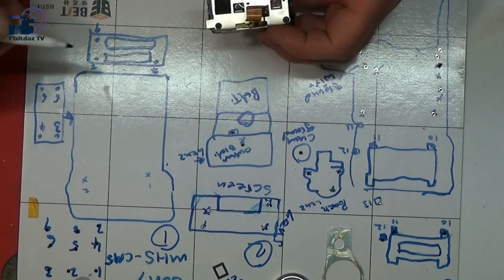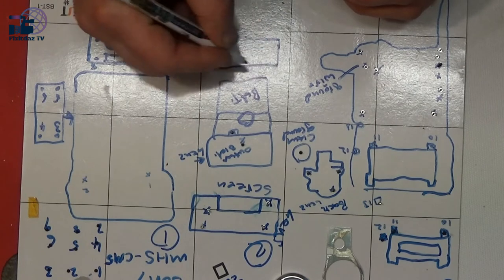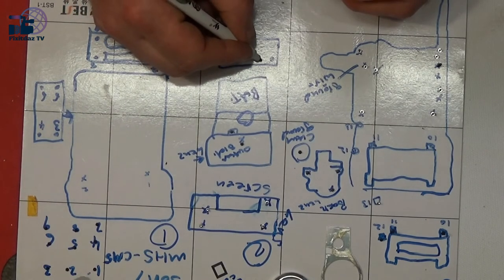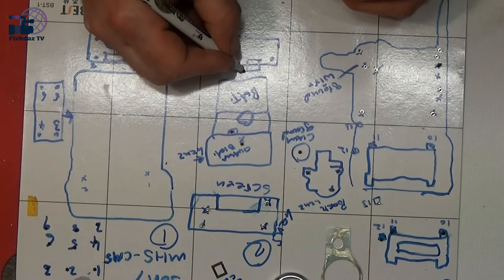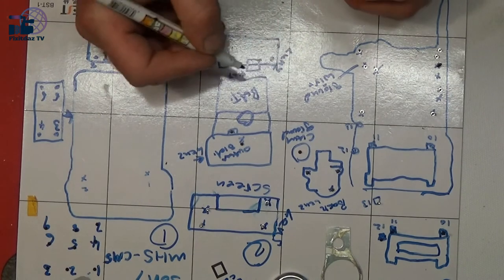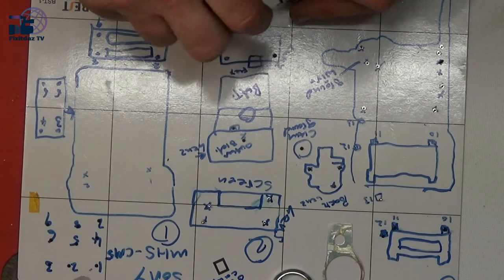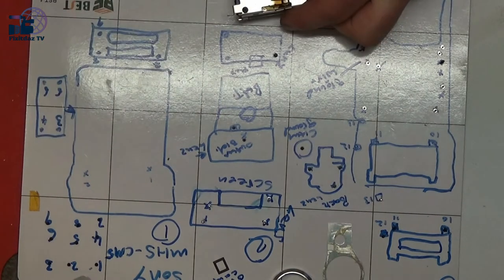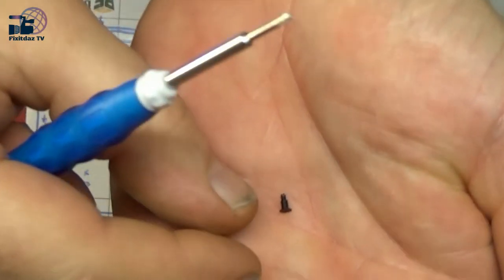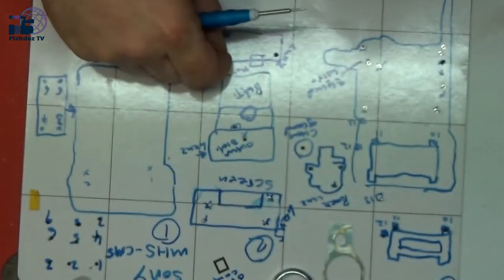We've drawn that up. Let me just draw this up so we've got the base of it. Running out of space here, so I'll just draw that. We've got 1, 2, and 3 screws, and flex cable, and the lens is here. Lens. So these, yeah, these are special screws. You've got like a little shoulder on them for the rubber mounts. Focus. So they'll have to go back in the right place definitely.